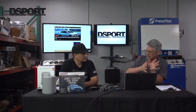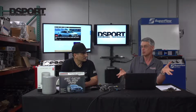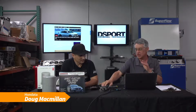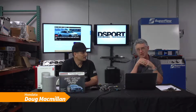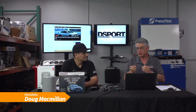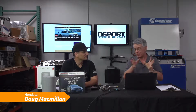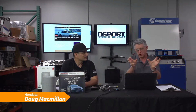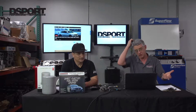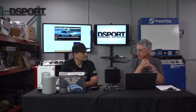And I'll segue into the next segment of direct injection. When we first started with it, we had no idea what we were dealing with and how it worked, and we just learned as we went along the way. But what I have learned is that direct injection and flex fuel is magic. When you're injecting high ethanol content fuels into a cylinder, it's like an in-cylinder intercooler. As the ethanol droplets evaporate, they cool the intake charge, so your charge is being cooled in the cylinder, and we can make a lot more power by being more aggressive in the tuning with high content ethanol. And so it's magic.